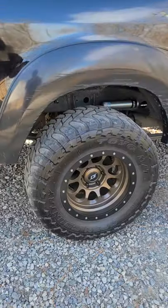Which do I prefer? I now prefer the smaller wheel and larger tire setup versus my old one. Would I ever go back? Yeah, I'm open-minded — if I saw a really clean 20 I'd be open to it. For now this is the look I want to keep. I do want to get an off-road bumper and there are other things I want to do. I was really looking at some KMCs but they were beadlocks, and for a daily driver that I'm also towing with I don't think it's worth the risk. If any of you know of some chrome or polished 17 by 9 high offset wheels — nothing less than negative 38 millimeter offset — comment down below.